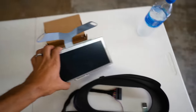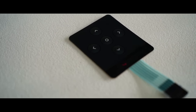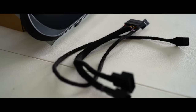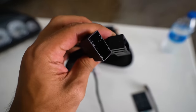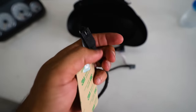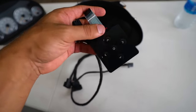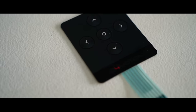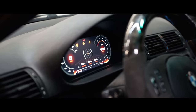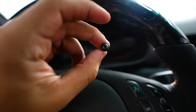You can also add an extended USB cable so once you install the cluster you don't have to remove it to update it. The top bracket falls right on top of the plastic piece where you use the two little bolts to tighten and install it properly in the dashboard. The best part about this upgrade is it's truly plug and play — no coding necessary. You literally connect to the factory components behind the dashboard, with one end going behind the cluster and the last connection being for the ID4 Motion remote that lets you control the display, change themes, and use added features.